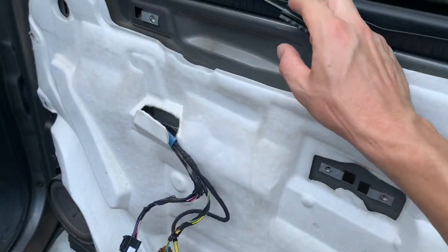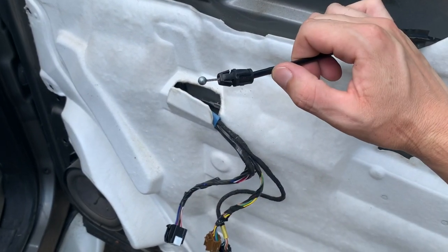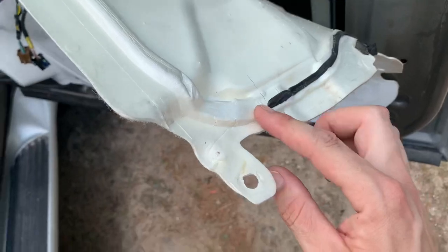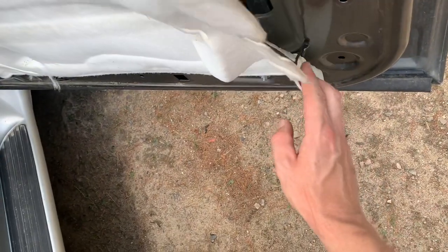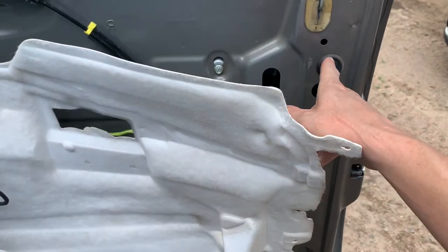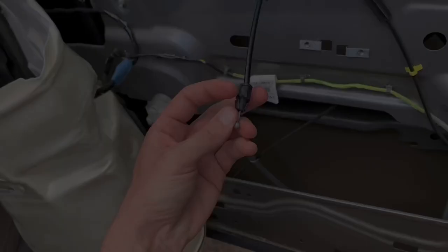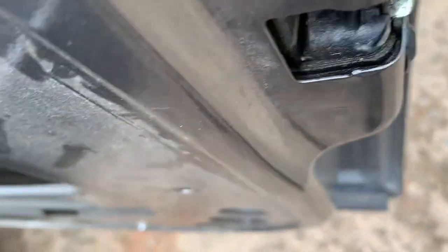If you need to get out your cable, that's the cable there that runs your interior handle — I've been into that before on these trucks, it's a common problem. If you're very careful, you can pull this back and we'll see if the bolts are there or if they're broken — why the exterior handle is loose. I can hear the latch when I pull on the cable, so that works.